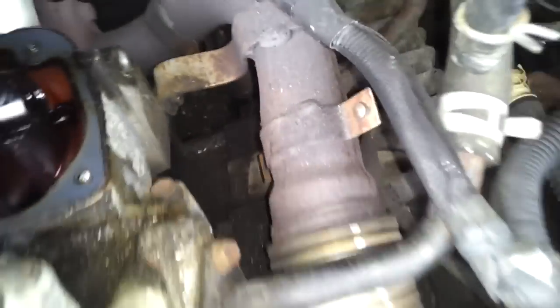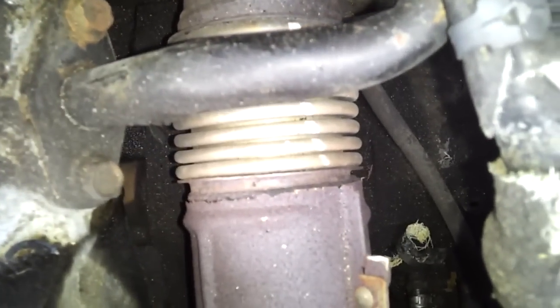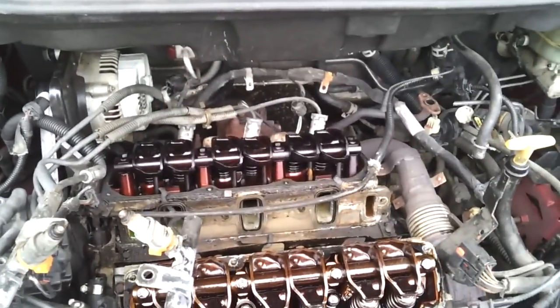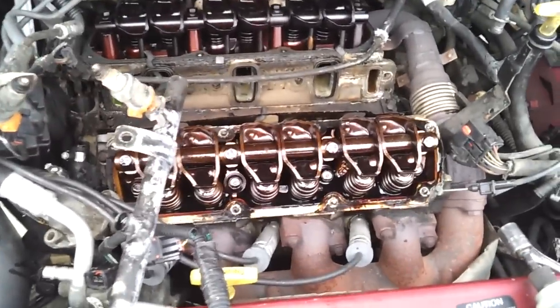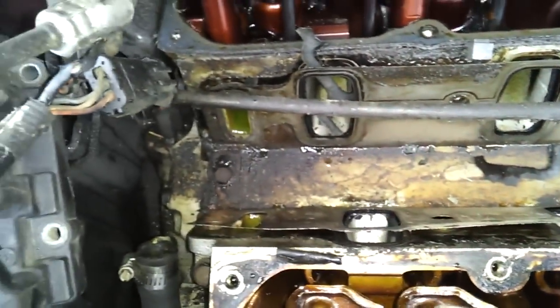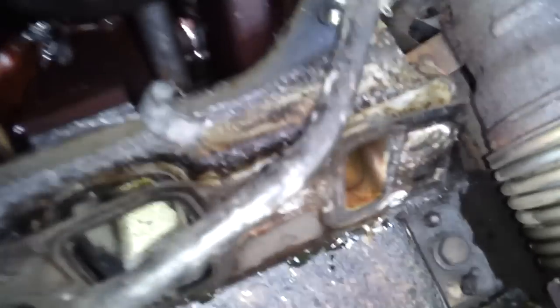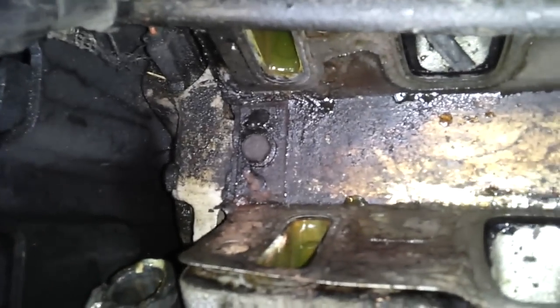It's time for me to take some pictures. I've also got a leak here in the exhaust — in this flex pipe or whatever you want to call it. Here's your transmission mount right here. Take advantage, guys. So we kind of completed everything we wanted out of part one. I took the plenum out, I took the valve covers off, and I took the lower intake manifold off. Here's what your engine looks like without the lower intake manifold. Here's the gasket — a flimsy little thing held down by two 10mm screws. These little tabs come in your new kit so you can throw the old ones out.